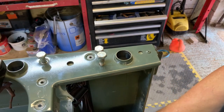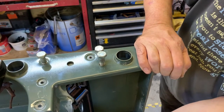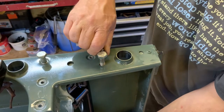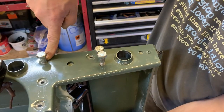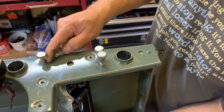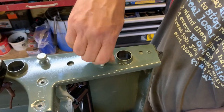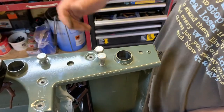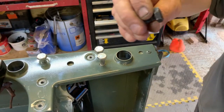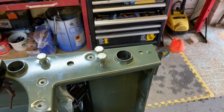Then that's going to fit down there, and that's going to bolt up against that wheel arch. It's not perfect. It's going to pull the aluminium out a bit because there's a bit of a gap at the back, at the bottom should I say, but it all comes off of this hole here, which is what you're stuck with. So if you're fitting one of these, you may want to move that hole forward. But as you can see, it's all lining up lovely. Control the bolts by fingers, so a good way of getting everything lined up is to get yourself a little bolt. If you've got a friend with a lathe, get them to stick it in the lathe and drill a hole through the centre, and then you can use that for centre finding.